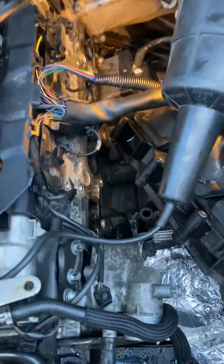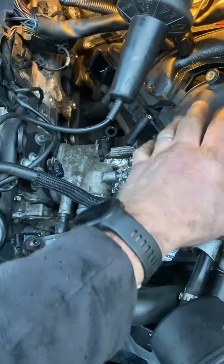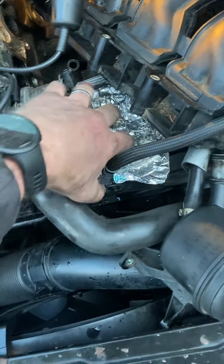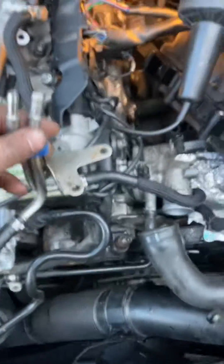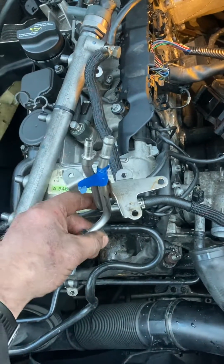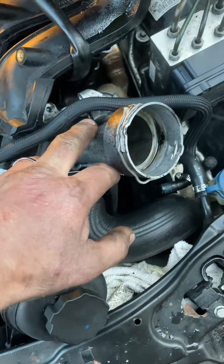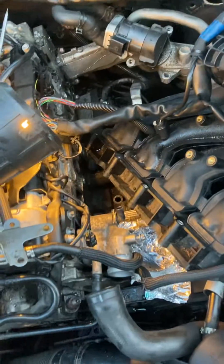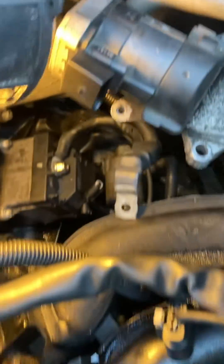So I've had to strip out the inlet manifold and the air intake. I had to take the thermostat off there and the oil filter off there. I moved my common rail and disconnected a couple of fuel pipes. I took away this charger bit here to help me get it out — just to get this off, basically, to get to the top of where my starter motor is.